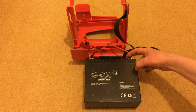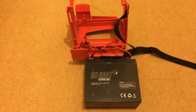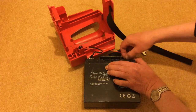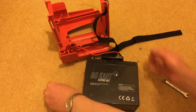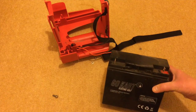Out comes the battery. Having folded that away, I'll now undo the positive and then the negative terminal on this battery, and make sure that the other battery goes in with the correct alignment. I'll also replace this connector as they provided a new spare part. That's the positive terminal taken off, and now I'll take the negative off. There's the old battery — I'll hang on to that until we can dispose of it safely.